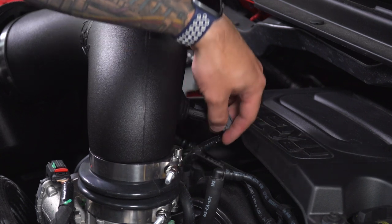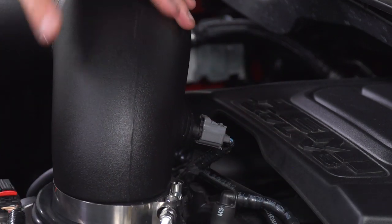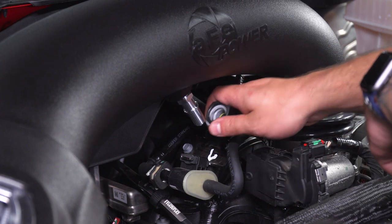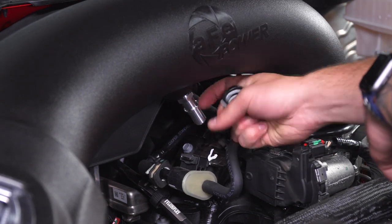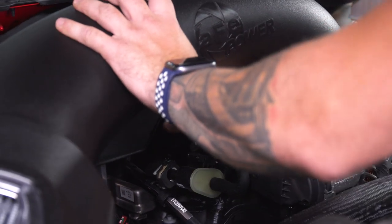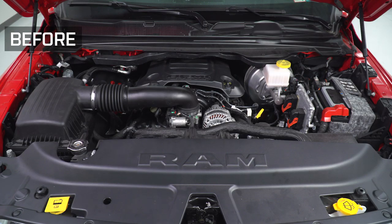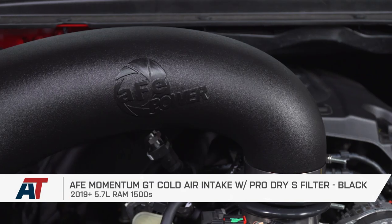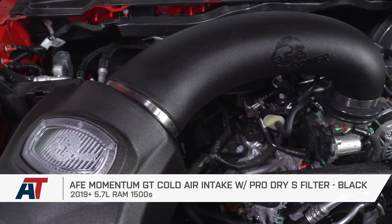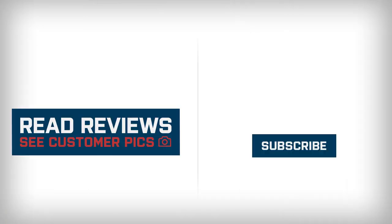Now let's connect the sensor and harness — just plug that in. Next, connect the factory hose to the new fitting. It's at a little bit of a weird angle, so push it around and possibly rotate the fitting connector to get it to seat. Snap it into place and you're good to go. That's gonna wrap up the review and install for the AFE Momentum GT cold air intake with the Pro-Dry S filter available in black for the 2019 and newer 5.7-equipped Ram 1500. You can get yours right here at americantrucks.com. We'll see you next time.